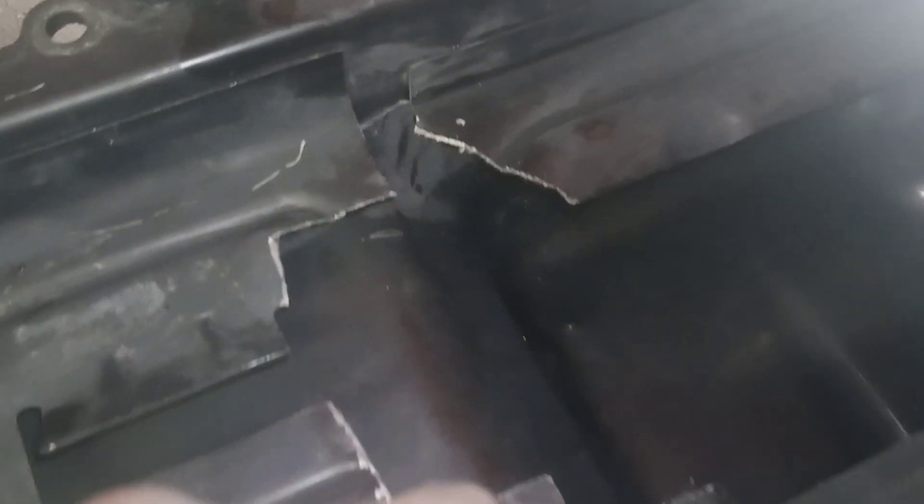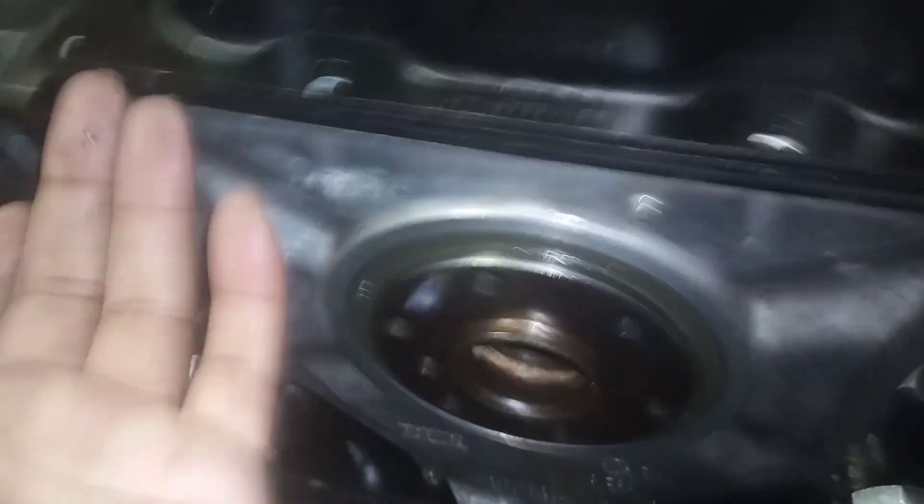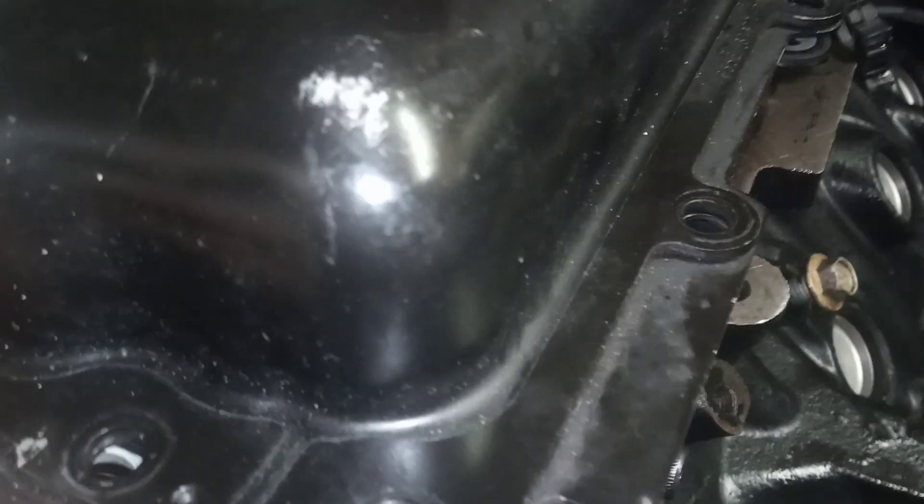If you're just trying to use a stock pan, this is what you're going to have to do. The oil pan is flat all the way around. I have to put sealant around the back — a bead goes right in here and over here under the gasket, so it'll mate against the rear main seal and the gasket — not between the pan and the gasket, but underneath it. A nice little bead on both sides. When it wasn't fitting, this part was sticking up, which is why I knew I had to cut some more.